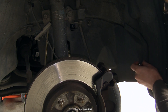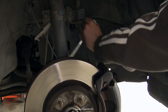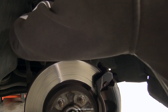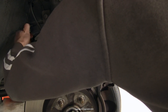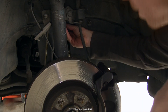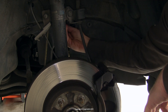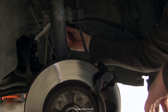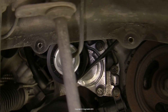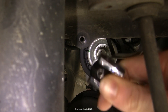Next, start taking the necessary bits off the alternator — the belt can go first. I've done other videos on the accessory drive on this engine; I've replaced a number of pulleys in the last six months, and also a video specifically on the belt itself. If you want to see this in more explicit detail, go have a look at those. In short, you access the belt tensioner through the wheel well, and you need a 15mm socket with a short extension and a bar to lever on the automatic tensioner.